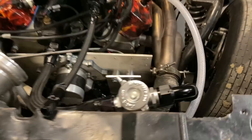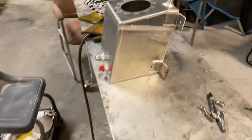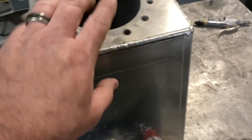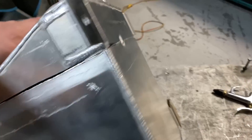We've been working on converting this car to methanol. Y'all just saw the video where I did the tune-up on the computer, so just a few more things and we're gonna see if it works — we're gonna try to get that thing fired up tonight. The fuel pump is mounted down there, belt drive. Brian got all this stuff done. We just had to cut a couple inches out of the fuel cell, so it's gonna be about two and a half gallons when it's all said and done.